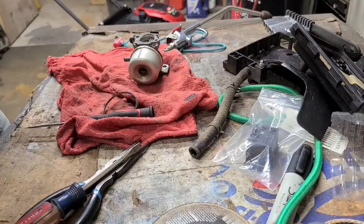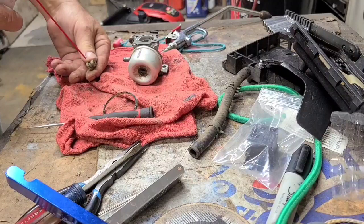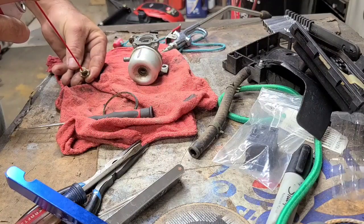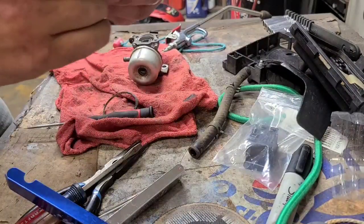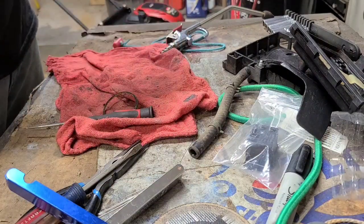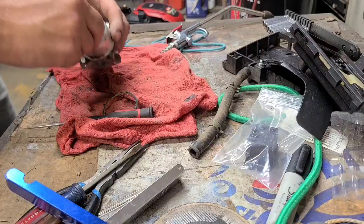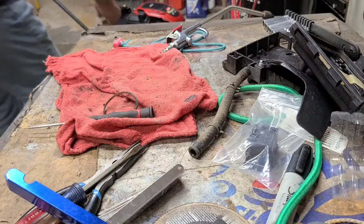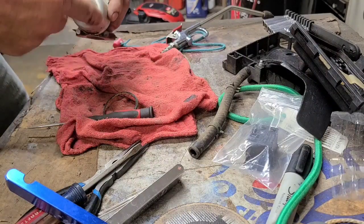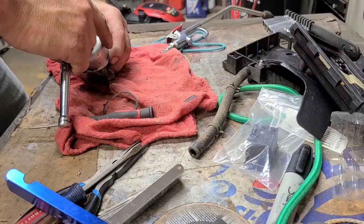Yeah, really big. You can blow right straight through this. It's a really big hole. It's clear. Comes in the top, out the sides. It's clear. Now will this bowl gasket fit? Like I said, it's a little bit thinner than that one, but technically it shouldn't overflow or leak unless the float isn't working. The fuel should never reach that level.